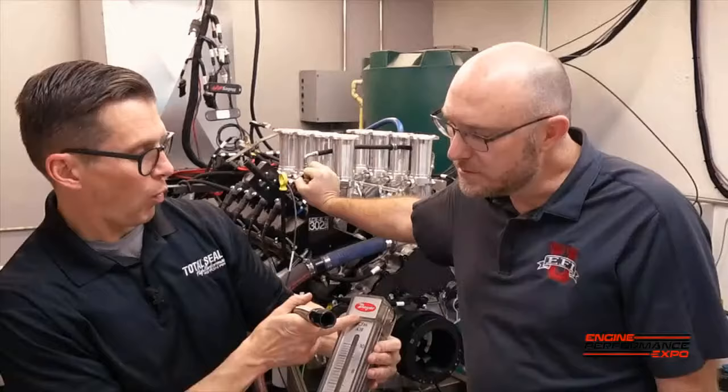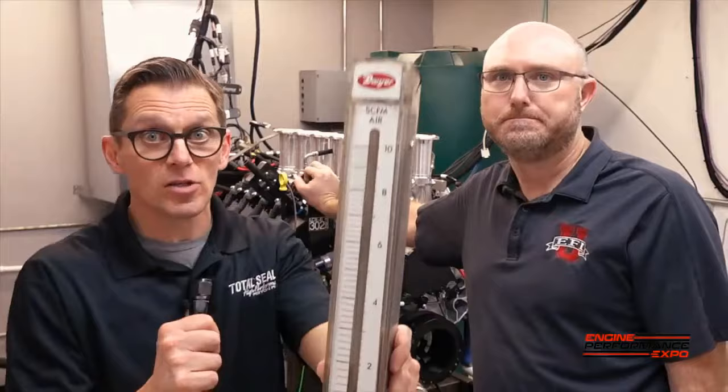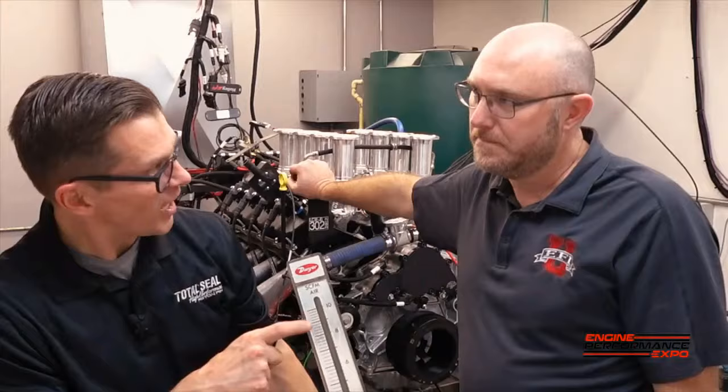When we've been doing it for a long time, there's a very affordable option — one of these. This is from Dwyer. It's like $100. It's a little analog unit with a little ball thing right here. You know, the engine has blow-by, right? There's gas and air getting behind the rings. It's in CFM, and this goes up to 10 CFM at the very top.